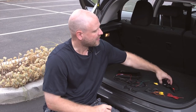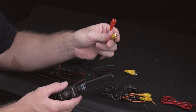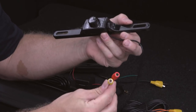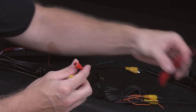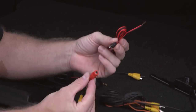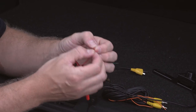We'll do the same with the camera, where we have the DC power jack and the RCA lead. After you've mounted your camera, you're going to run this to the inside of the vehicle, and from there you're going to connect the power cord — the male DC power connector to the female DC power connector — and then you're going to have your red lead and your power lead.